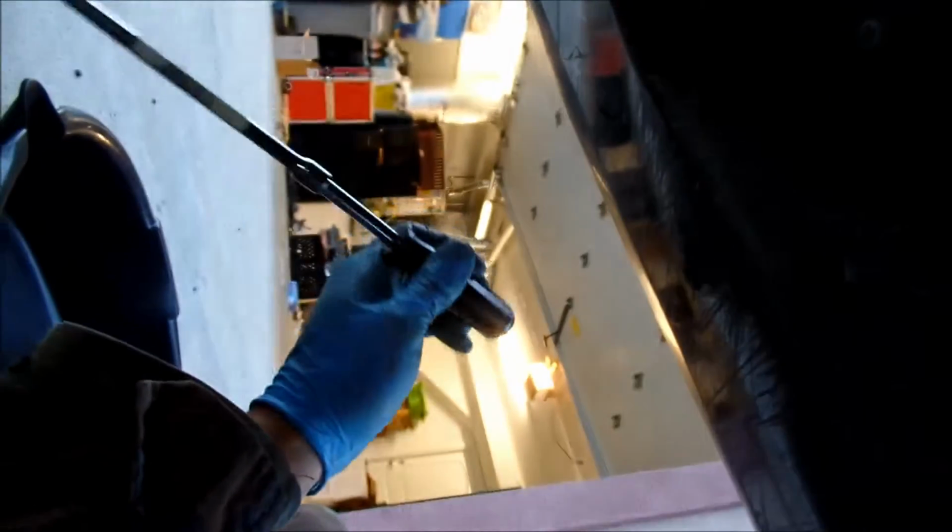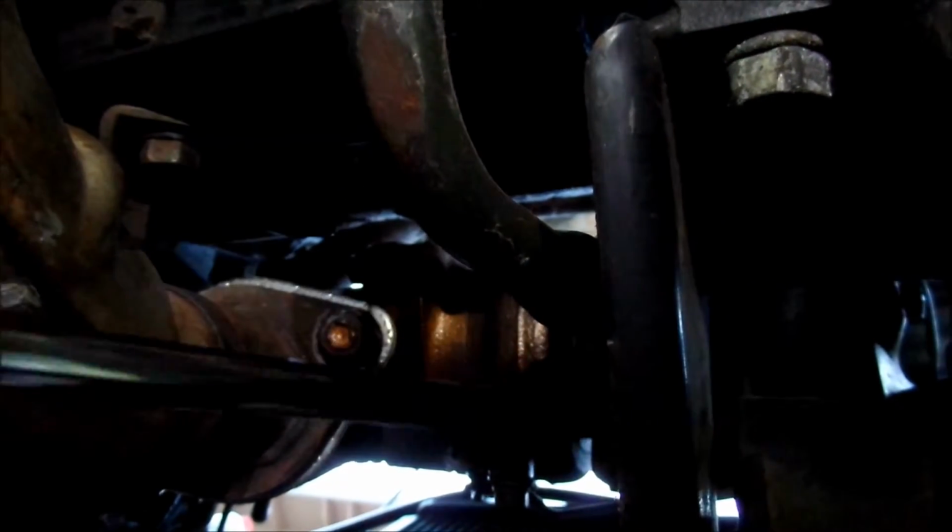This tool here, it's like a screwdriver with a 1/4-inch tip and an extension. It makes this job much easier. Muy fácil, right? Something like that. And then you can just get it from here. Easy. And then you just use that, and I'm going to torque it later with a wrench. And then, for the O2 housing, this tool makes it easy to screw in. It's like a breaker bar. It's a baby breaker bar. The big one, I'm pretty sure, will not fit under here. It's too long. And you just use it to screw it in like a screwdriver, basically.